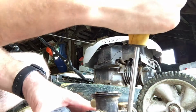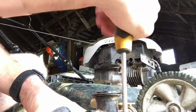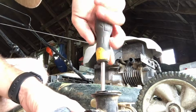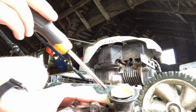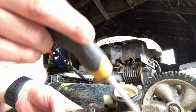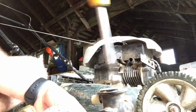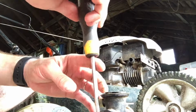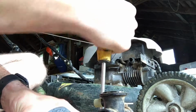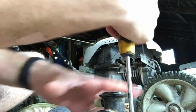And when you tighten them down, like with a lot of things, you want to tighten them like you're tightening down your lug nuts. You go from one corner, like we'll start up here, go opposite corner, then we'll come back to this side down at the bottom, then we'll go opposite corner up here. And just as much as you can, alternate sides. It just helps to give you a good tight seal with your gasket without pinching or bubbling anywhere.